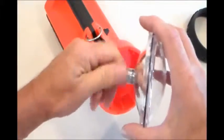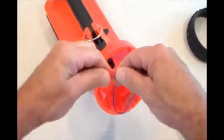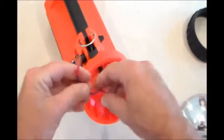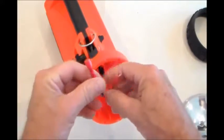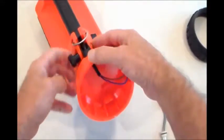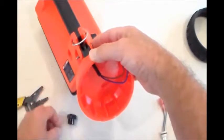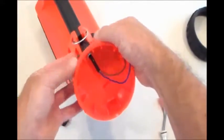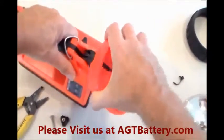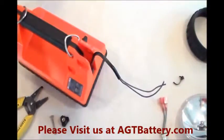Here we're taking the terminals off. You have to take these two terminals off because they won't fit through the channel going through the housing. So we cut those off and then snake them through the housing. We'll snake the new wire harness back up through the housing, and the only splicing or crimping you have to do is re-crimp the provided fast-on tabs to that wire once you feed it back up through the housing and replace the circuit board.